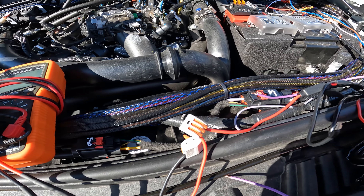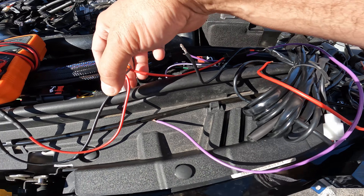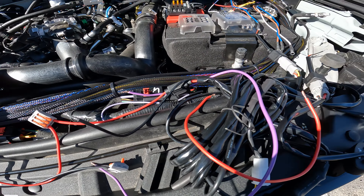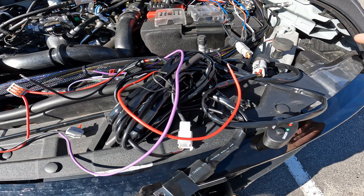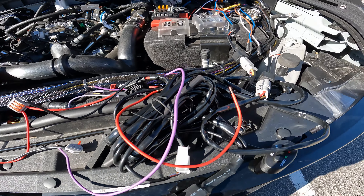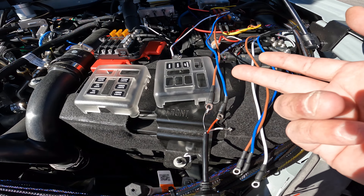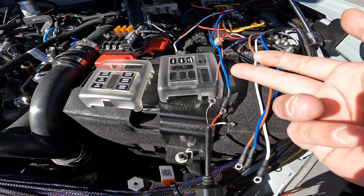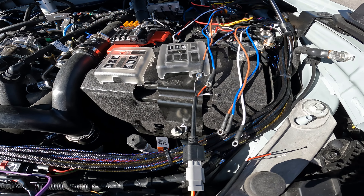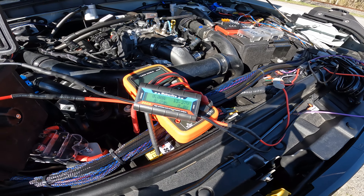This wires up to the harness which came with the aux beam lights. I currently do not have the ground fastened, because fastening it will energize the circuit through the harness. When I cut the switch on, the relay trips, completes the circuit, and then feeds power to the light. I ran out of red wire, so blue is the positive and brown is the negative. The white wire is the trigger wire for the different modes, so it's not necessary to use.